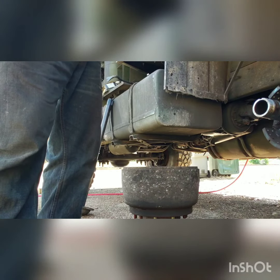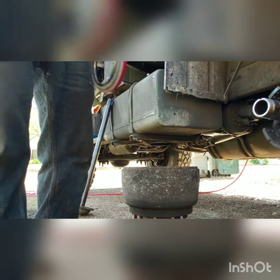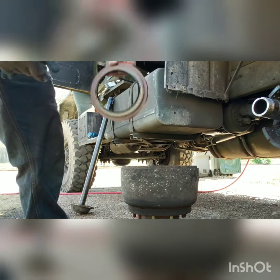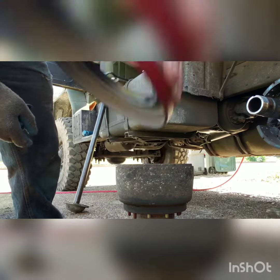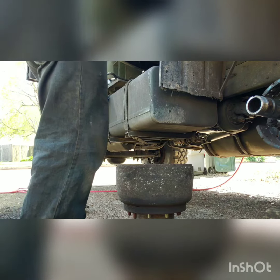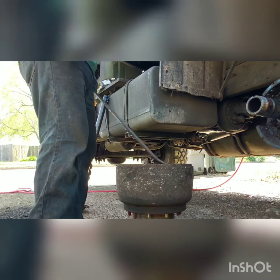Working on some five-ton drums, replacing the rear seal in the hub. Sometimes these can be a real pain to get out because of that little indention lip — and they're pretty deep usually, pretty good-sized steel. I've seen people try a screwdriver on the outside to knock it out, but what works best is a normal crowbar. If you get a longer crowbar, that's fine.